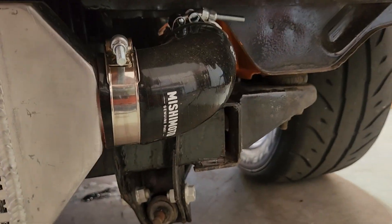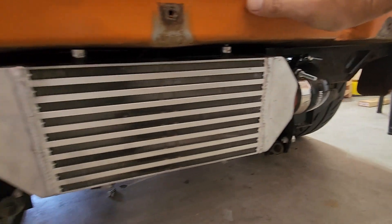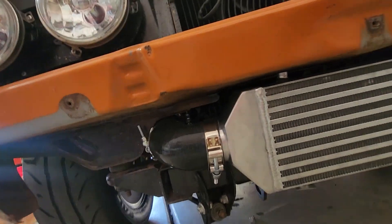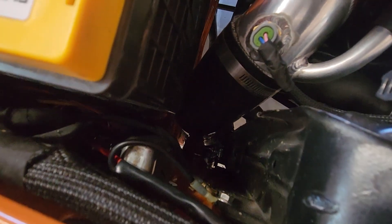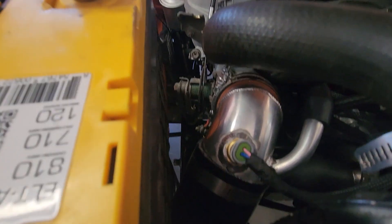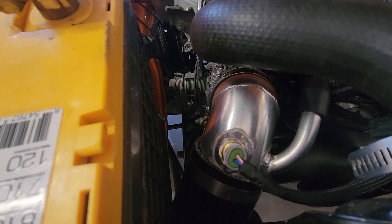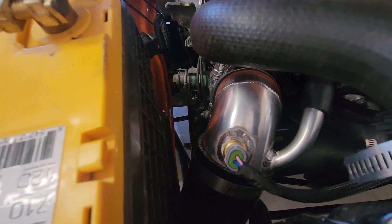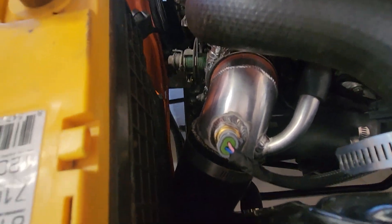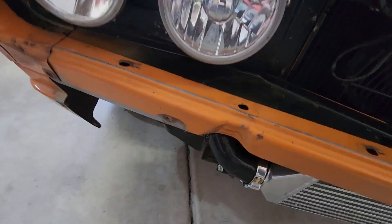So it's a 90 degree off the pipe coming down into the intercooler. Coming up from the intercooler, there's a 90 degree pipe that's two and a half inches. Then as you come up to the KA's throttle body, you have two and three quarter inches into the throttle body. This pipe is also from the 240SX CX Racing kit — I cut it up and had someone weld a bung in. So you have the throttle body at two and three quarters inches, and then a silicone reducer joiner that goes from two and three quarters down to two and a half, connecting to the pipe that runs down to the intercooler. That's all the air plumbing.